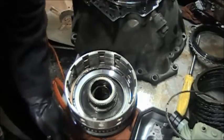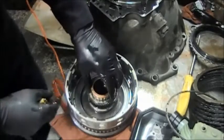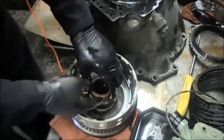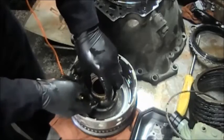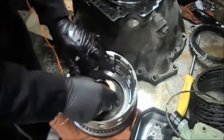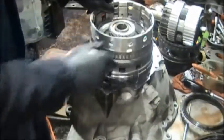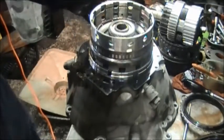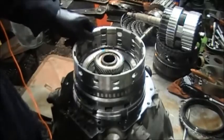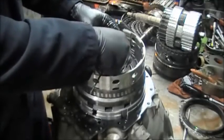This sprag has two washers on it. You take one of the washers off, make sure it's even with the old sprag, and just set it in. Once you get this sprag in, you want to set it on top of the bell housing and turn it. Make sure that you put it in the right way — remember clockwise freewheel, counterclockwise lock — and then put the snap ring back in.